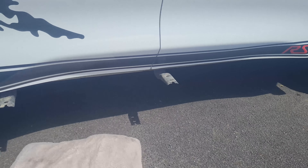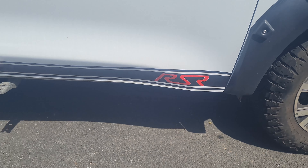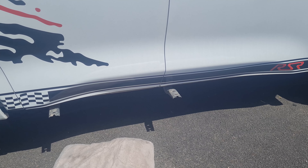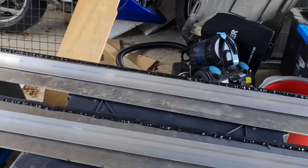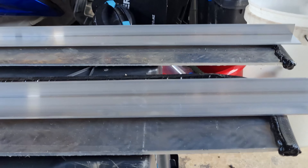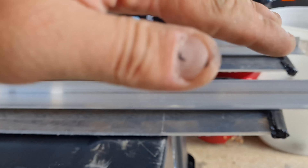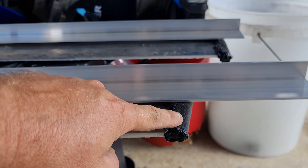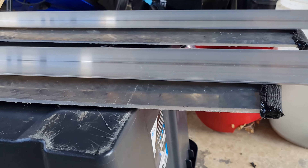So there's three mounts along here. I've taken the front one off because I had a rock and it needs a paint before I finish the job. My plan is just to replace it with a flat check plate aluminium sidestep. Here's my sidestep upside down — it's just regular old 5mm check plate aluminium. I've got this 50x25x3mm thick angle which I'm going to put underneath to give it a bit of strength to stop the alloy from flexing. And to get a warrant of fitness I've bought this edging, which I will link to in the description, so that if I bump into someone's shins I don't scratch them up and therefore fail a warrant of fitness.